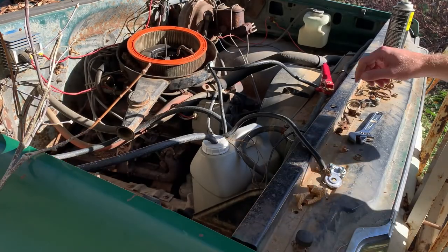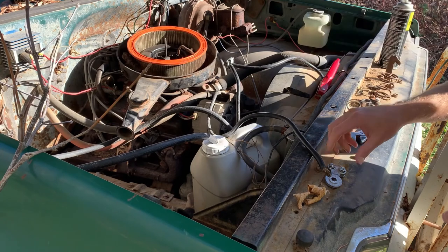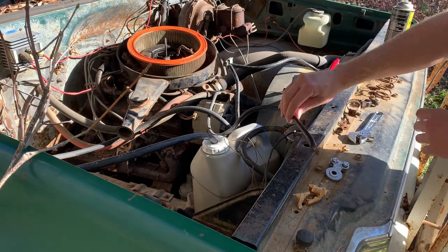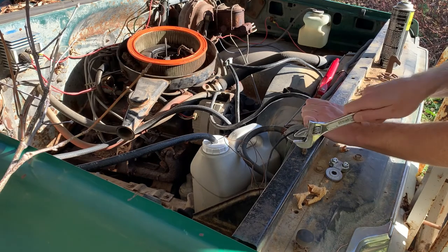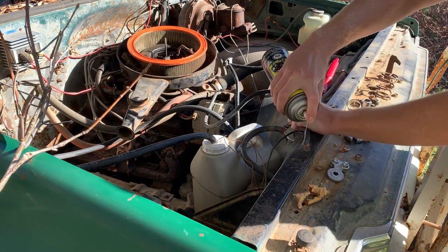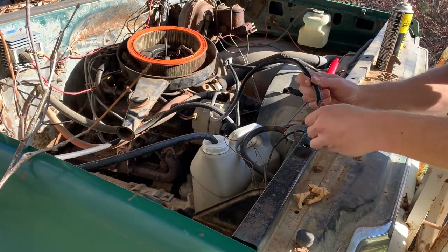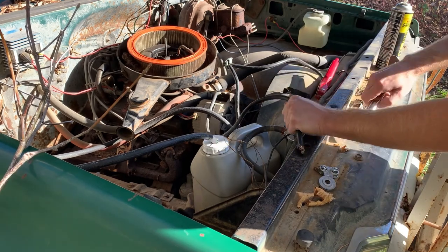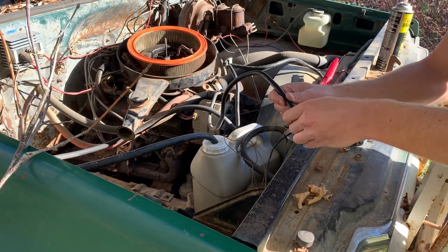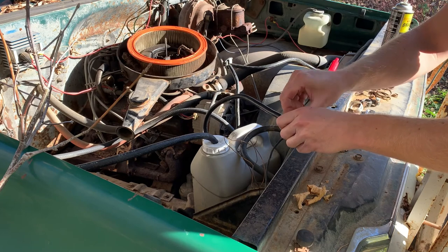I'm thinking probably a good idea to get rid of this custom cable extender here. I'm just going to throw on a set of these side post terminals. Kind of a GM special, so might as well. Got that off. I'm just going to give it a quick clean. I'm going to ease that in. We'll have this ready to go, I'm hoping soon. We're going to test it like this. We should have some better results. Here's hoping, right?